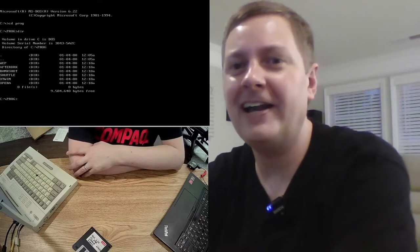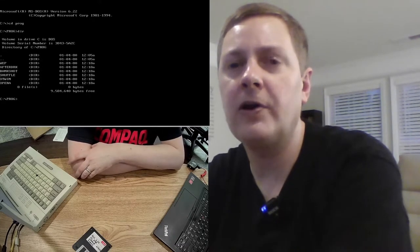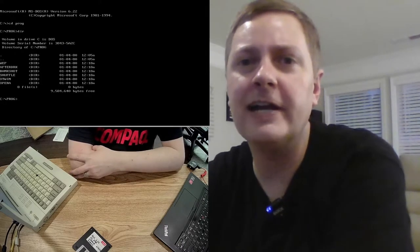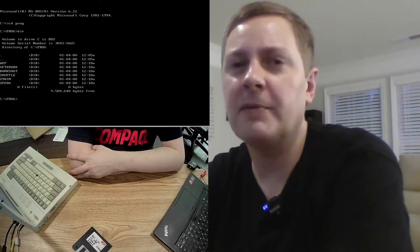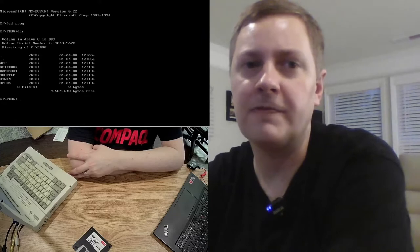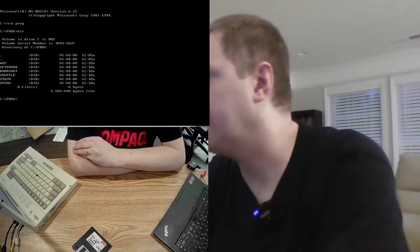The one caveat, as I discovered earlier when I screwed up and installed Windows 98, and then went on to try and install it again because I wanted to get some good footage, is I ended up with a Windows.000 directory, and the Vinyl driver was not smart enough to figure that out. So just make sure you have a Windows directory, and you should be fine.